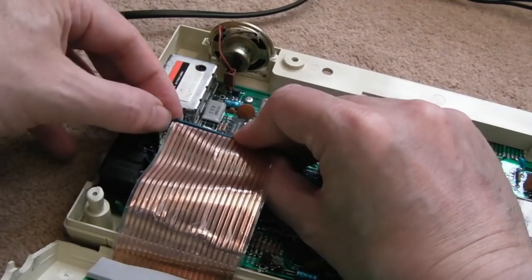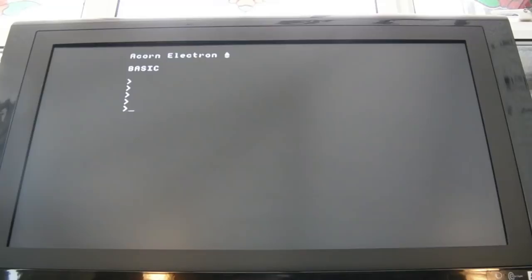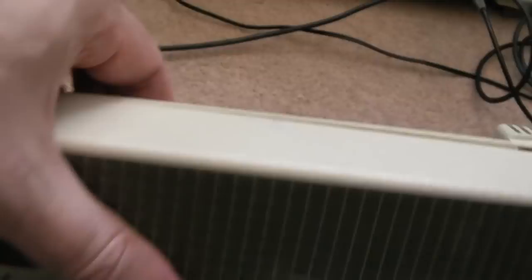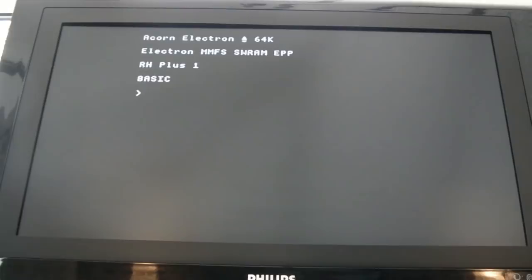Getting the four board screws back in. One capacitor looks weirdly bent - straightening that right out. Reconnecting the speaker - plus to the right it goes that way around. The silicon/mastic holds it in the ridge. Connecting the keyboard strip to the pins and pushing down. Some reassembly trouble - a piece of plastic broke off but I can glue that back in a minute. Putting the top back on, connecting power and we get a little beep. Pressing Break loses the Acorn icon, but that's normal behavior.